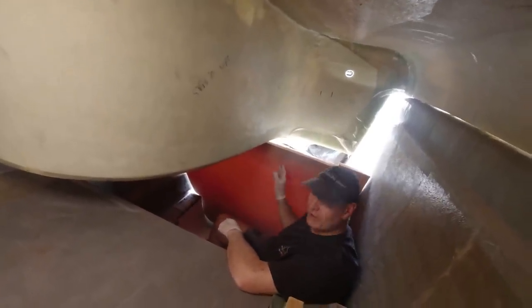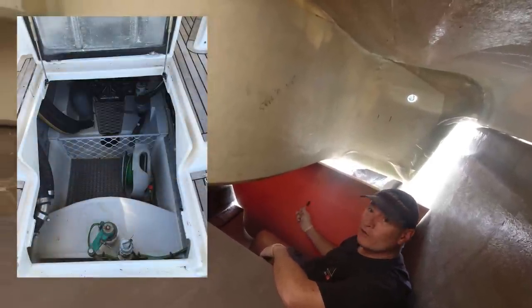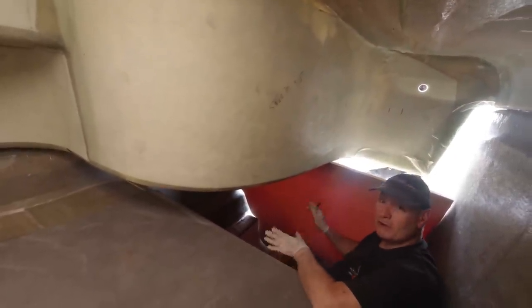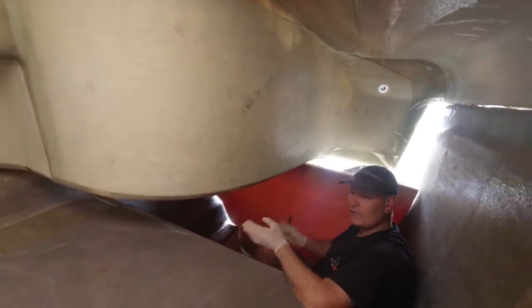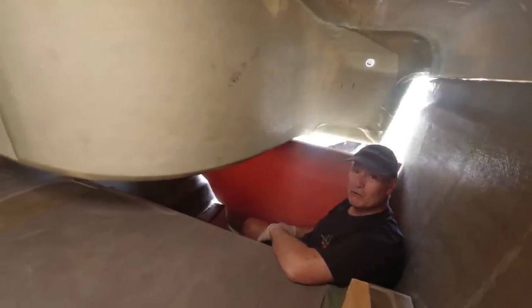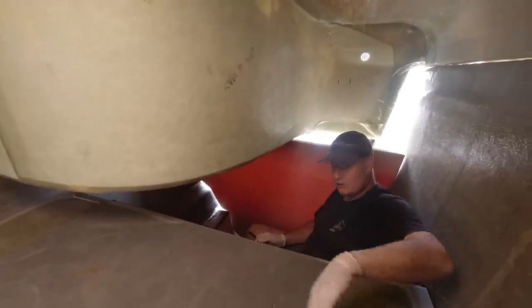This will be a door big enough for me to get through, sealed with four hatches and a seal. I'll be putting carbon unidirectional around the outside of the door to make sure it's a really rigid structure — you just laminate that into the bulkhead itself. That'll also stop rain from getting into the bilges, because at the moment rain is coming in and going into the bilges. That's taken me three days to fabricate that piece of foam, and I'm ready to do the other one tomorrow.